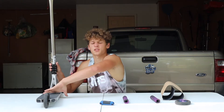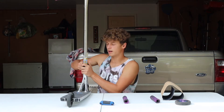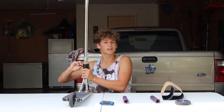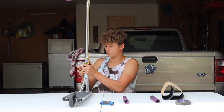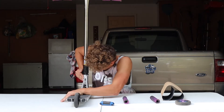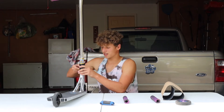First things first, I take off the bars so it's easier to handle. Make sure when you take off the bars — if you have a four-clamp bolt or even a two — make sure you loosen one a little bit at a time. Don't loosen one all the way and then try to loosen the other all the way, because that will weaken your clamp and maybe your bolts. Whoever tightened that clamp must have been really strong, because that was hard.